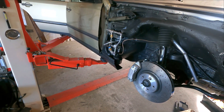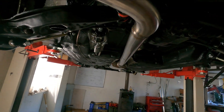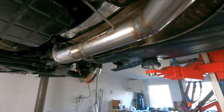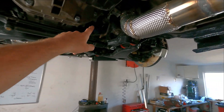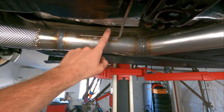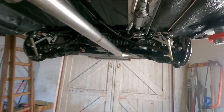That is also why you have problems with this kind of suspension laying flat on the ground, because it is just the spring that is helping the system. I am going to raise the car and show you where I am going to install everything. This part you will not find in an R129 or W201 or W124 - that is what I built. I already changed some angles in the exhaust because I had some fitment issues, because I don't have a flex pipe in this exhaust. The engine is very hard on the engine mount, so it is not really needed, but then the exhaust needs to be perfect.